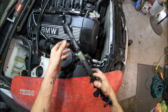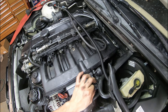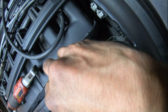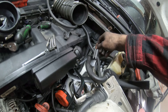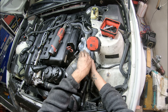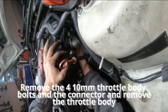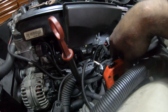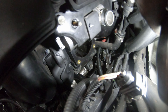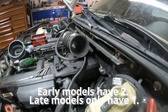You can see where the other end of this smaller pipe connects to. Get those two hoses out of the way while you're over here, might as well disconnect this connector and move that out of the way. To get some more room when removing this you can take out this partition here - it's just a 10mm bolt and then it pulls right out. There's a nut for a support bracket on the manifold. You do have to pull out the throttle body to get to that, and there's also some vacuum lines back here that you need to disconnect.